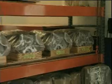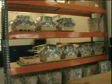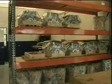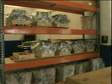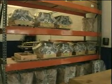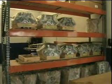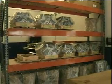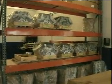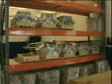And as you can see, like I said before, Sean's modifying one to accept a 3-valve engine with a Saleen supercharger. We have as well some Cobra iron blocks, Stroker versions. Everything we do with the 4.6 right now is a 298 Stroker version. We figured if you're going to go with these forged internals, might as well gain a couple cubic inches for a little extra horsepower. We try to go with standard bore on every block, and every block we usually use is brand new. We will commission some used blocks, or also known as seasoned blocks, to be built, but that's at the customer's request.